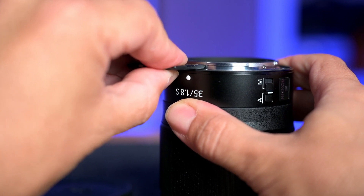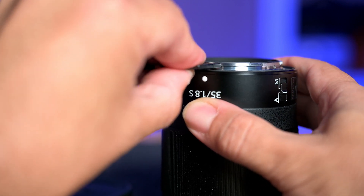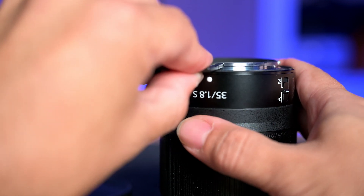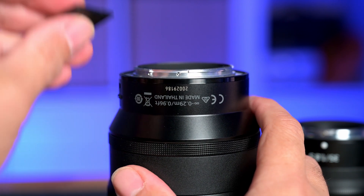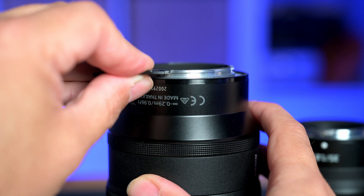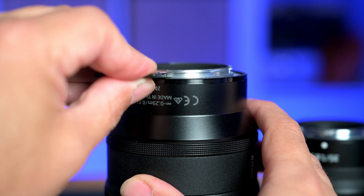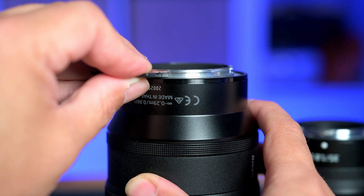The leaf spring is stopping the lens from locking in position — that is the issue. If you look at the edge of the 35mm f1.8 bayonet, you can see it is quite sharp, quite a clean neat edge. Now if I pop out my 105mm and do exactly the same thing — placing it against the edge — you can see the 105mm bayonet edge is slightly, fractionally rounder.